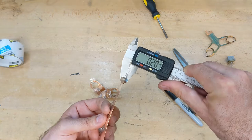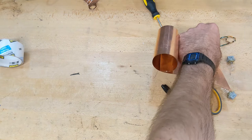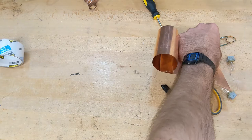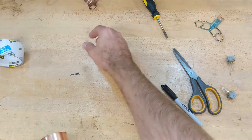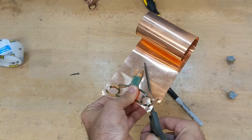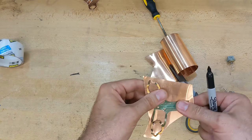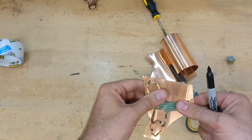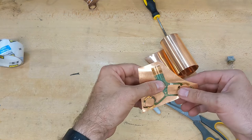So this is what I'm going to use - I already made it and it works great. I'm going to show you how I did it because I don't think you can buy this printed circuit separately - I think you have to buy the whole console. So I'm going to take the original, just lay it across, and cut this thin copper with household scissors - no problem, super easy to do. You can use a marker or a sharpie to mark the outline of exactly where you're cutting, or you can just hold it with your thumb and cut until you get what you want.